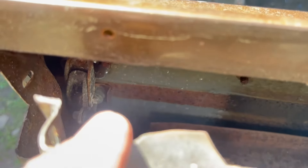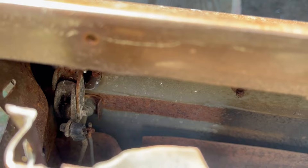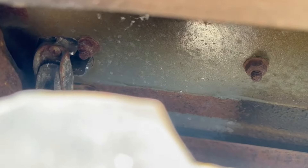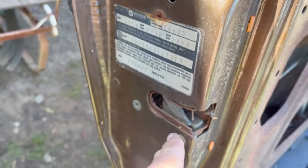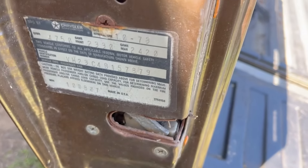You can see the two nuts right here and the one on the other side - that's the door handle. And then there's a plastic clip that holds the lock rod on. There are two lock rods and one will come out with a clip down here. I'm also going to remove the latch mechanism - sometimes these can be stubborn. Three bolts, and you usually need an impact hammer for that.